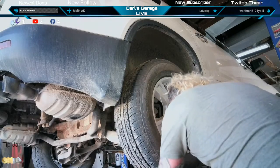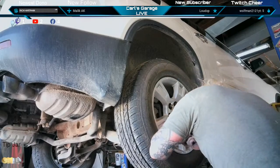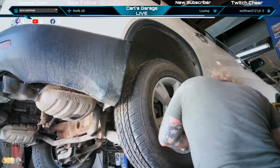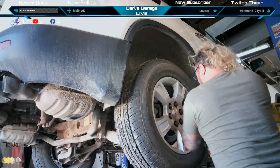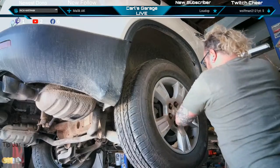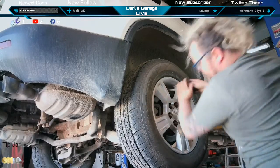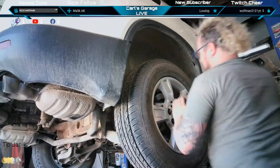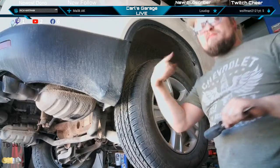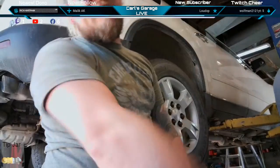Push that backing plate back a little bit. We did a lot of hammering on it. Find out where it's catching, and there's a huge rust lip on the rotor. So it's probably just coming around rubbing that rust lip. All-wheel drive, no front-wheel drive on this one.